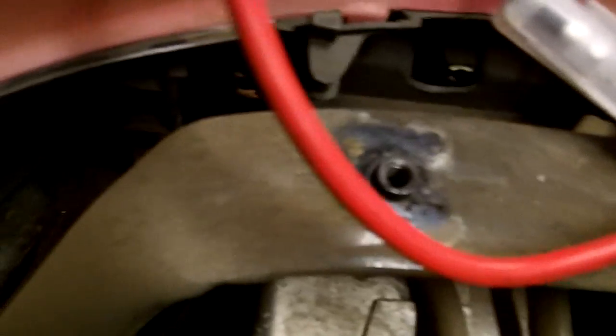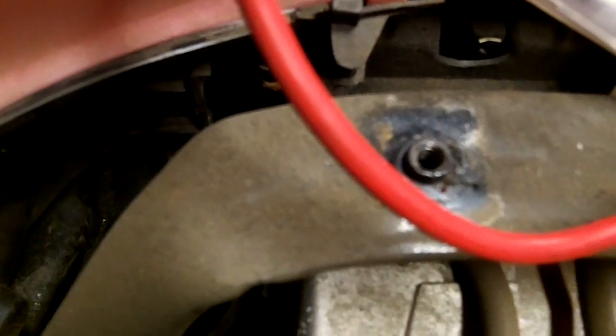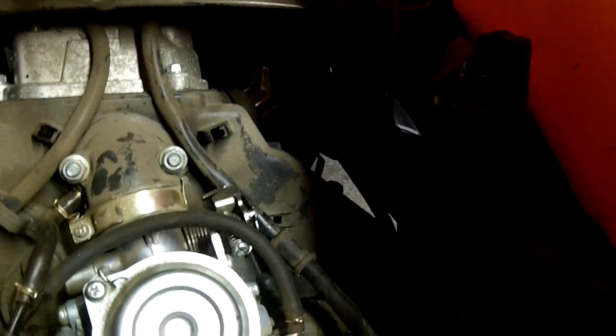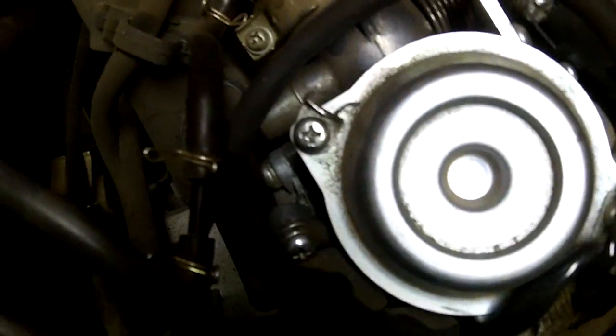So to remove the plastics, I've got to take the rack off, and then I can pull the plastics off the back of the bike. Some parts that give common problems on these. Here's the auto enricher for the carburetor. Here's the starter solenoid. Here's the fuse holder. I don't know if this one's stock or not. This one actually carries an extra fuse, it looks like, inside. Fuel pump. These give problems. And then the vacuum lines. Vacuum lines are usually cheap Chinese vacuum lines, and they give problems. So, although these don't look so bad, they look like they're in pretty good shape.